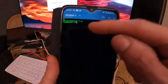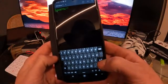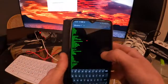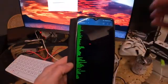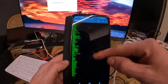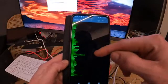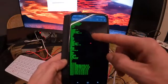So yeah, now I hacked it with a script to do su, so I'm root, and then I do ash to get a better shell, and then I can do tap tap, and these are all the tools the phone has. So the phone has a lot of tools and a lot of sensors. It has a GPS with GLONASS and all the positioning. You can debug the GPS even with root. So it should be pretty accurate for speed. And then yeah, you basically have a full root shell.